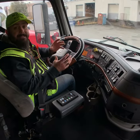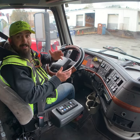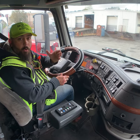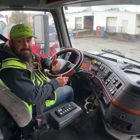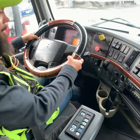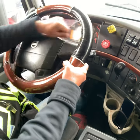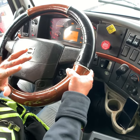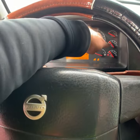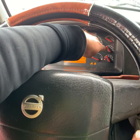Second one, test name: low air warning test. Explain: the low air warning light or buzzer should come on at or above 55 psi. Do it. I will pump my service brake. Pump, pump. When you are close to 60, pump more slowly. Yes. The low air warning light came on at 55 psi. It's working properly. The truck passed the test.